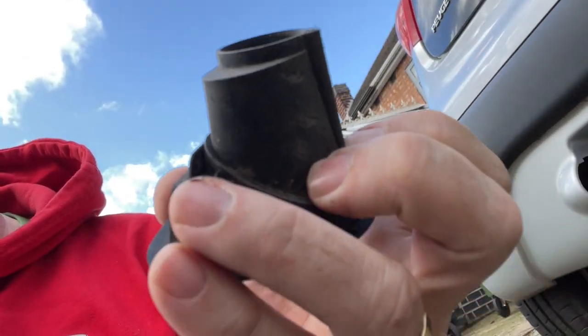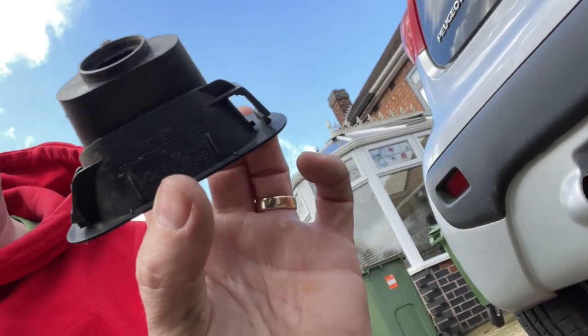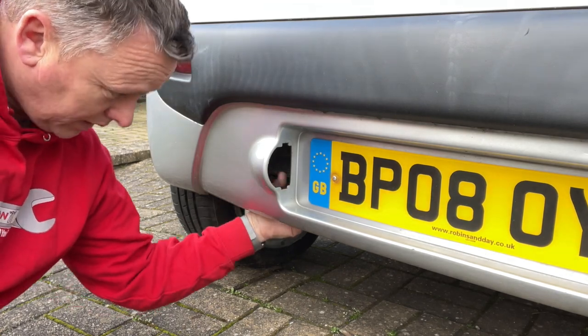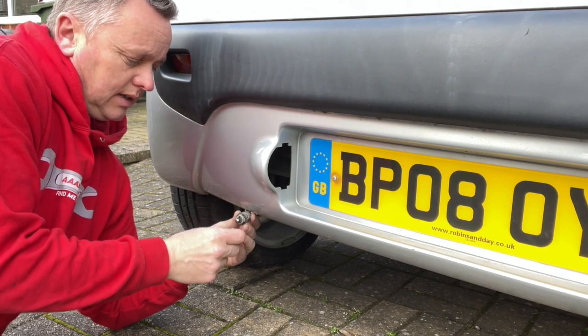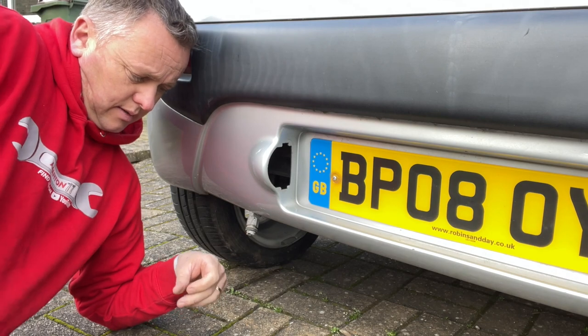But also we can release these bulb holders by pressing, there's a tab on the top and a tab on the bottom, and you can press those tabs. Watch, you don't drop it, though. Oops. Those out. Oh, the top one just slides. It's the tab on the bottom that releases it then. So you got a little tab there, you just squeeze, pop that out. Right, let's have a look then. So our little wire, which I've took out the back there, here it is. Okay, so again, capless bulb, just pull it out.